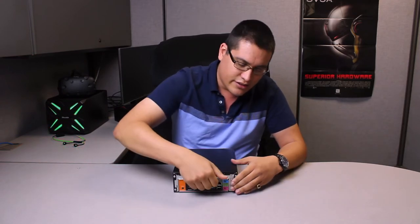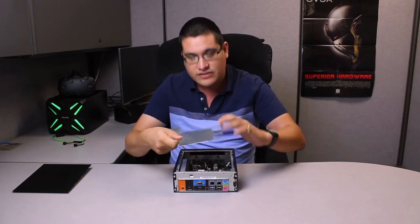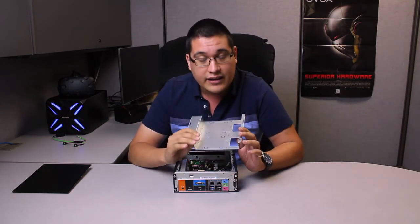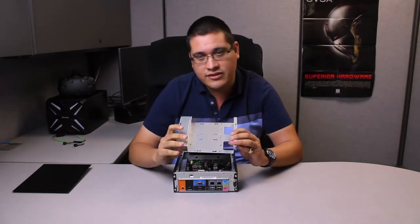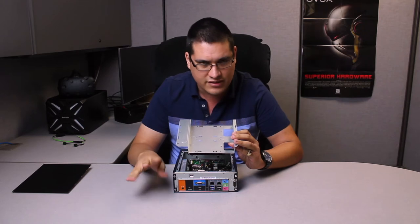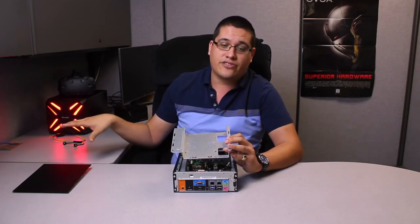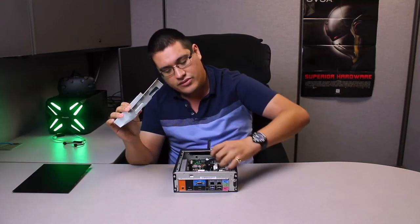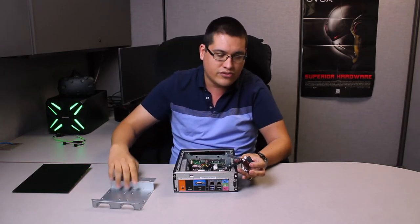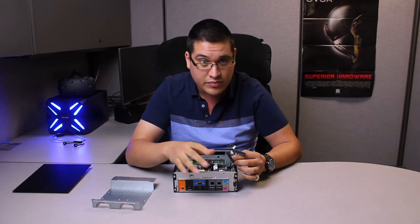Let's take a look at the inside. Two thumb screws — I've already undone all the screws for the sake of time. Just pull this up and you get access to the cover. The first thing you see is the bracket. This bracket has been redesigned and it can accommodate four 2.5-inch drives — thickness of 7.5 to 9 millimeters. Full technical specs will be in the link below. There's a set of brackets in the accessory box that allow you to mount basically two and two. And here are all the SATA cables — no more Y cables, no more data cables. You got your four cables here; plug them into the drives and you're good to go.